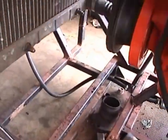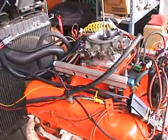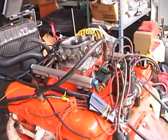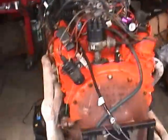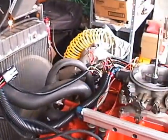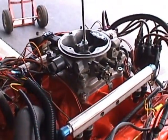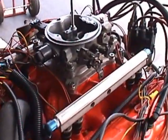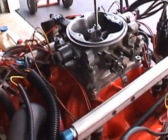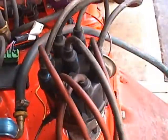Timing is all set — I do that with all the spark plugs out, ignition hooked up, cranking fast to build oil pressure and set timing. Once this gets into the car to replace the Holley, it self-tunes and it's great. They came out with a newer version supposed to be released in March — it's April now — and that one also self-tunes and controls spark. I wish I had that one, but right now I'm using a stock Mopar electronic ignition distributor.